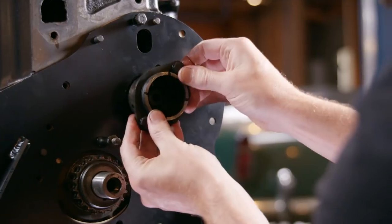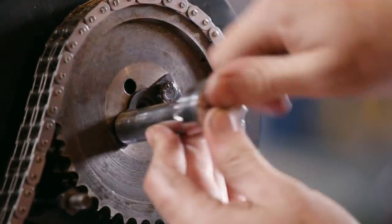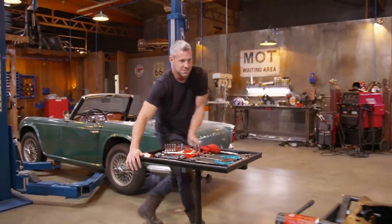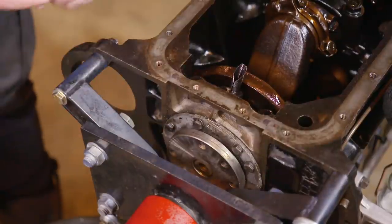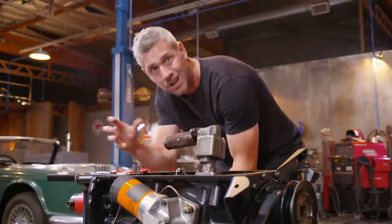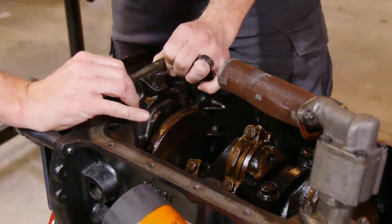The TR4 motor is a real piece of utilitarian art — no superfluous gadgetry, just real old school mechanical reliability. From its double timing chain to its simple spring tensioners, this engine is a true workhorse. Now before I refit the sump, the reason I'm here in the first place is the rear main seal. I've done a ton of rear main seals and normally you just take the gearbox off, lose the clutch and the flywheel to get access. But on this engine, unfortunately you have to leave the sump off because I'm releasing this main cap here.